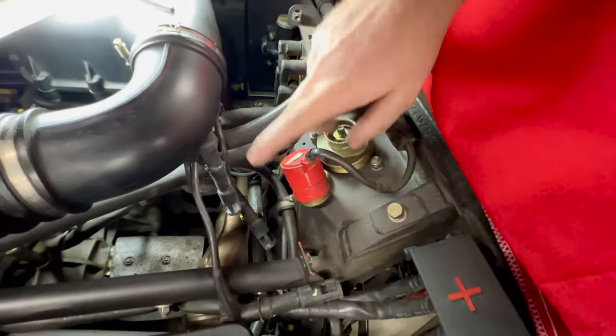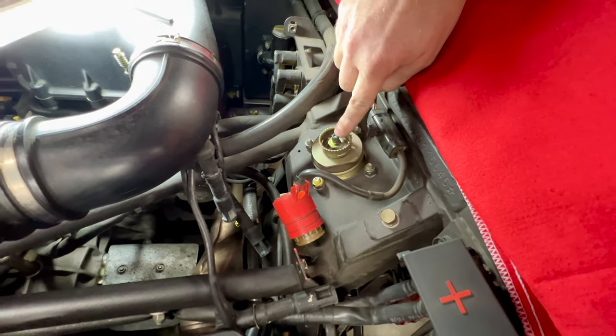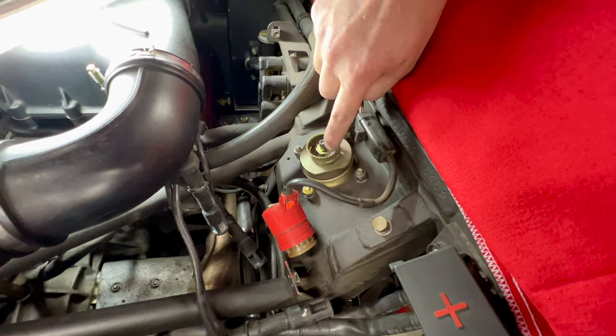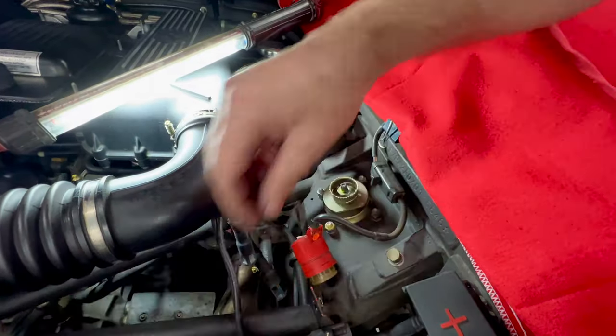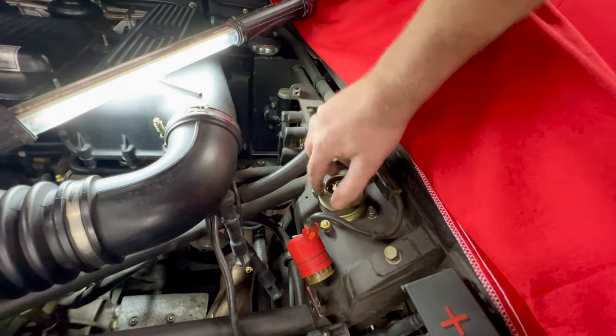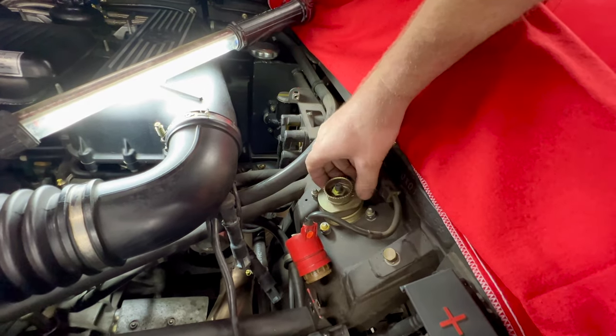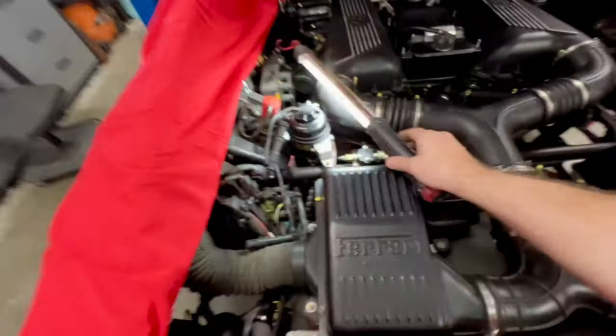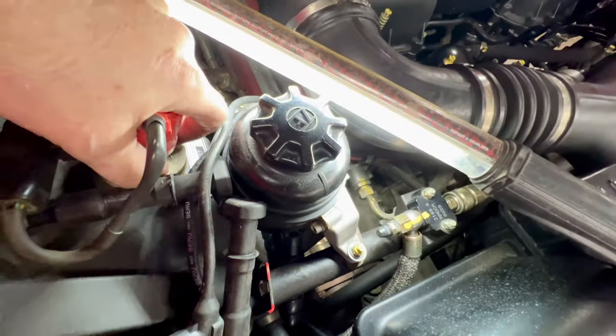So this one's good. Our actuator's not broken. Our gear's not broken. And there's no oil leaking up through the shock up here. It's dry. Now on the fronts, I have already checked those and there's no broken gears or actuators, although there is a little bit of seeping of oil coming up. So we will note that down. And then we will jump over to this side and give it a quick check as well.